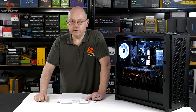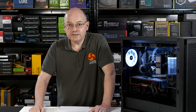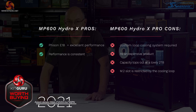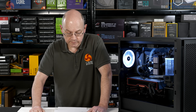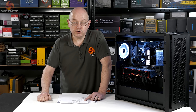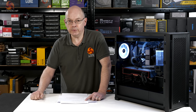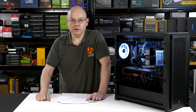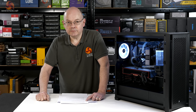Corsair charges a stiff premium — you're paying a lot of money for this 2TB SSD compared to many other Gen 4 SSDs, and it is only available as a 2TB; you can't get a 4 or even 8TB drive. If they do move to 120-layer NAND in a month or three, that will probably just mean fewer NAND chips per side rather than higher capacity. Installation of the liquid-cooled drive also restricts your M.2 slot choice — if you have cooling armour on the bottom of your motherboard, you're not putting the drive down there. The slot above the graphics card is the obvious location, but depending on your motherboard, installation could prove tricky.